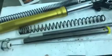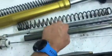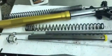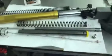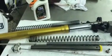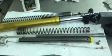A lot of contamination goes on inside this fork. These unfinished metals inside are going to get a lot of black, just dirty. There's going to be a lot of contamination in the oil, so it's going to be critical to service these forks every 30 to 40 hours — probably longer than that on the street, maybe once a year depending on how hard you are on the bike.